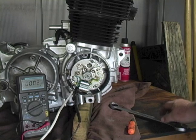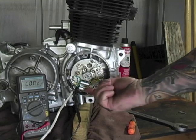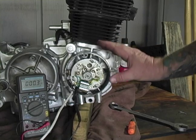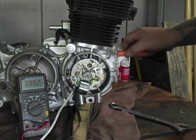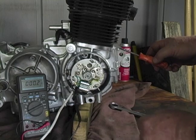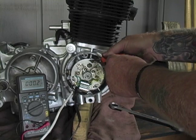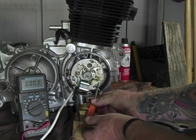I'm pretty close. If I need to make a little adjustment, keep in mind which way this is going. I'm turning this way, that means the bump has to come up this way. Which means if I want to get that to open, I've got to turn that breaker plate that way. The screws are just snug — they're not too tight — so it's not going to take a whole lot to move this around. We can give it a little coax here, just do a little bump.